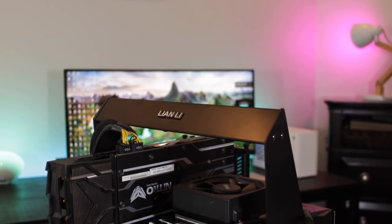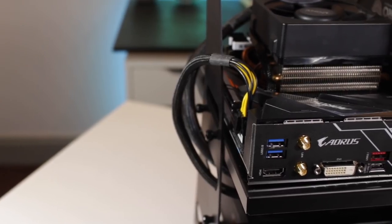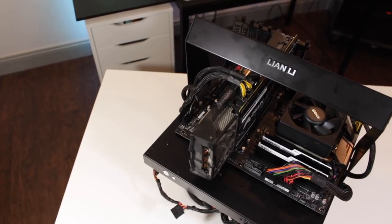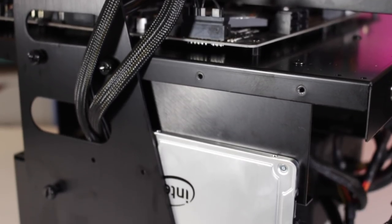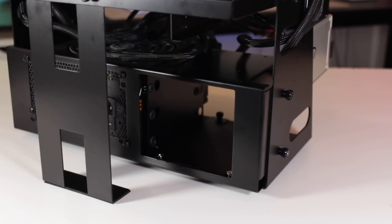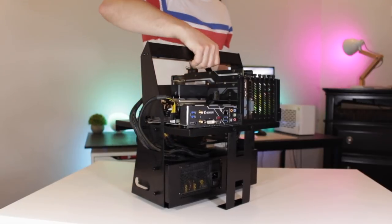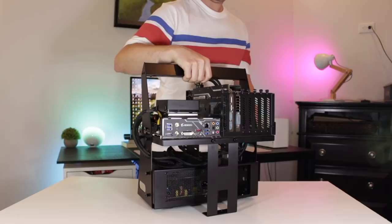As you can see, this test bench turned out pretty good — I just threw in this old R9 Fury as an example. This test bench is going to be great for testing GPUs, RAM, CPU coolers, SSDs, and other AM4 CPUs. This is definitely a work in progress and will evolve in the coming weeks and months. One thing I messed up on was not installing the 2.5-inch drive mount, meaning I had to improvise on the SSD installation. The bench can hold a pretty good amount of hardware including three 3.5-inch drives and dual 5.25-inch bays. The all-aluminum design makes it light but it's still surprisingly sturdy, and with the handle properly installed I feel confident even shaking it around.